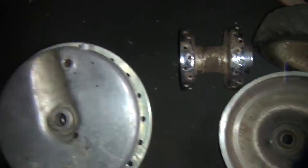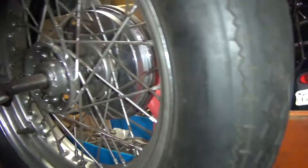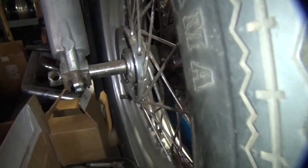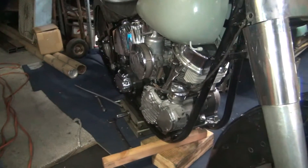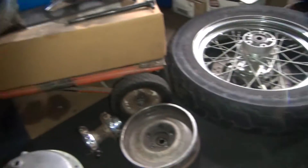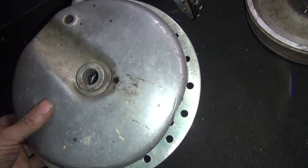The other thing I'm playing with is I want to do a twin brake. So instead of running just a single drum like right here, I was thinking about running a twin drum brake. But this bike is going to be a little faster than the other Panhead '57 — it's going to be at least a 100-inch motor, maybe up to a 130-inch motor. It'll still be a Panhead though. So I need more stopping power.